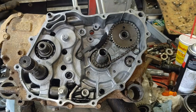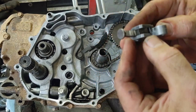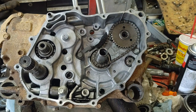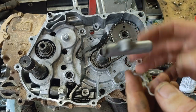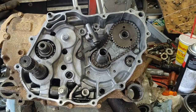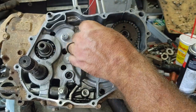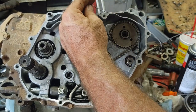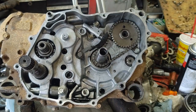Since this is a brand new crankshaft, I knocked the keyway out of the old one and need to tap it back in — without it, the flywheel will just spin around. Next, the cam chain tensioner: it's spring-loaded. Push down the little ramp piece with the spring behind it, push the tensioner in, and hold it with your finger. Stick a piece of stainless steel wire through the hole to hold the tensioner loaded until you get the two 10-millimeter bolts in. Once bolted, snap the wire out — you should see barely any movement, meaning the chain has plenty of life left.